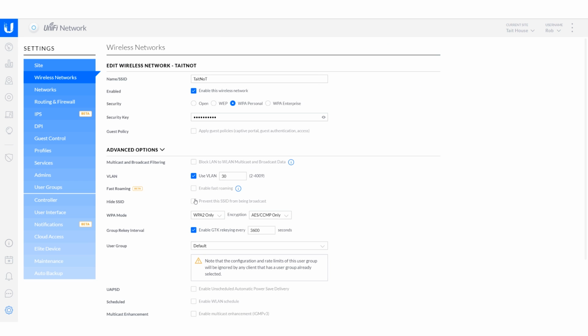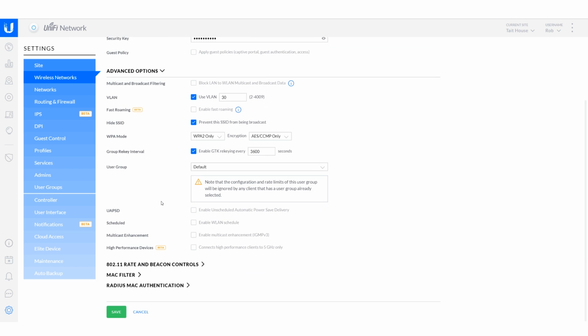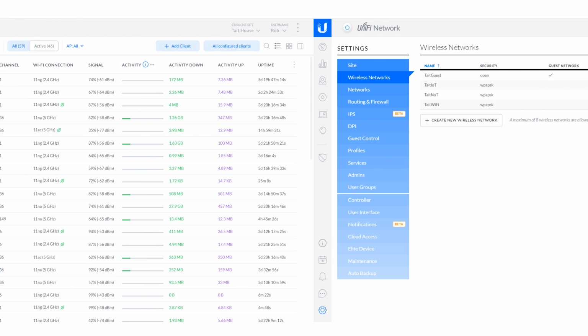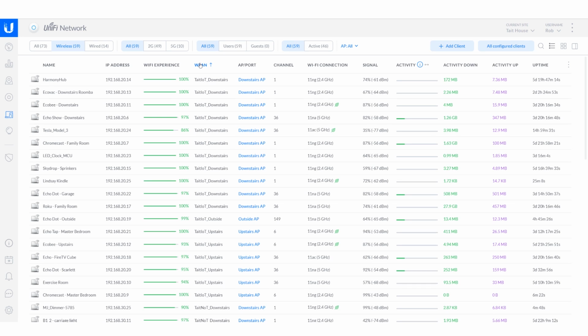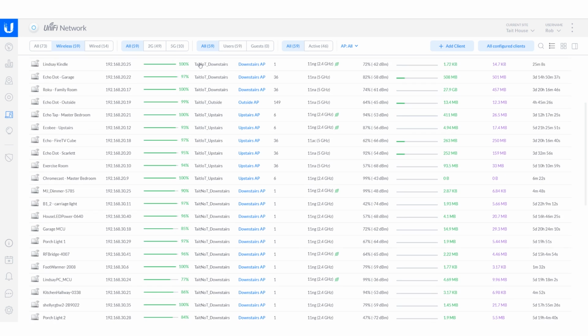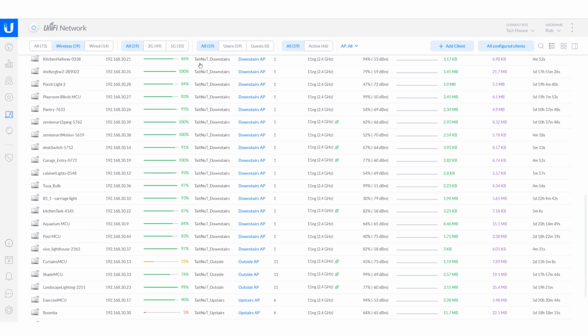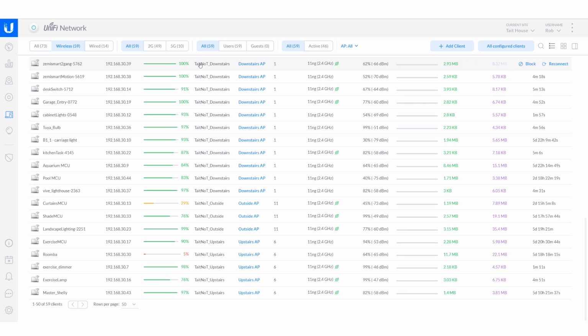A quick note though, at the time of publishing this video, Amazon Echo devices have a bug that stops them from properly connecting to hidden SSIDs. So I've been forced to leave my IoT SSIDs visible until they correct that bug. In the client list, you should now be able to sort your connected devices by their SSID for a super satisfying result. In part 3 of this series, we're going to assign different VLANs and firewall rules to these SSIDs to keep your network as safe, secure, and robust as possible.